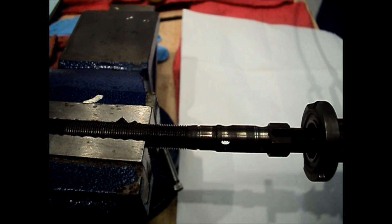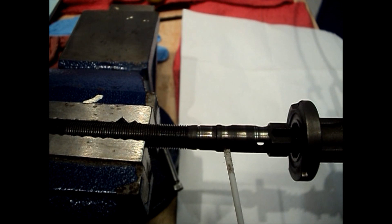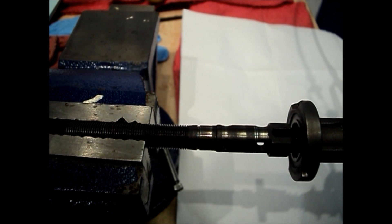We shift to the second gear position and they change places. Now we can see the daylight through the hole where the large sun gear rotates, and this one is closed off. So the small sun gear is coupled to the axle.